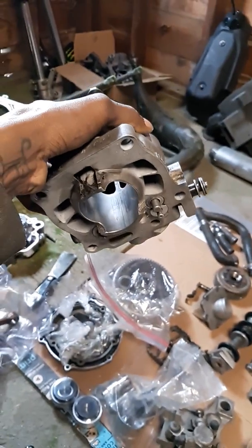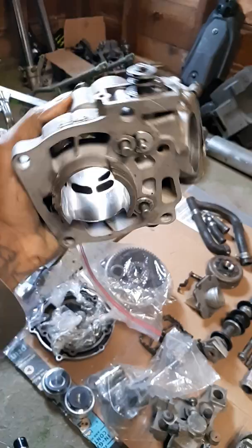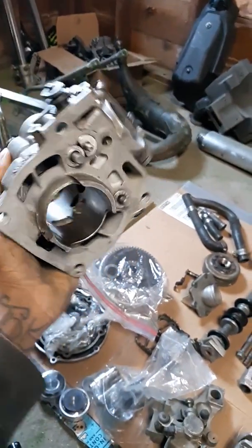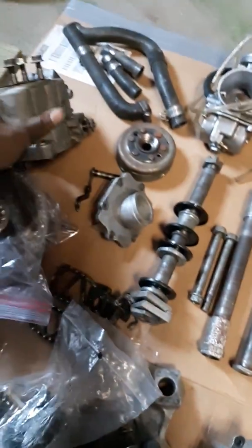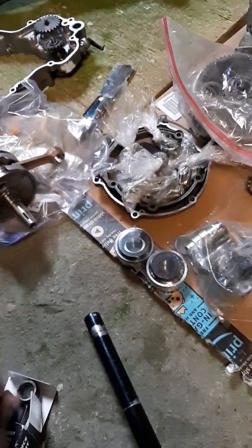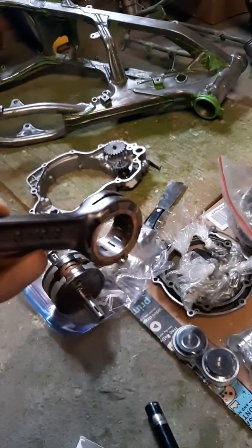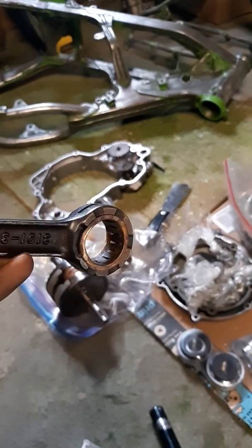I don't know where it was. Right there. Not like too bad. I mean, besides finger smudges everywhere, the cylinder was pretty clean. The piston slid right out. It was actually this rod bearing, which was just completely shot. It was seized to the crank.